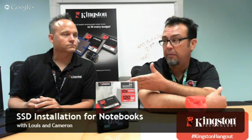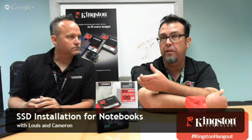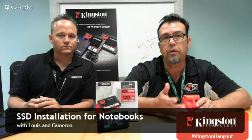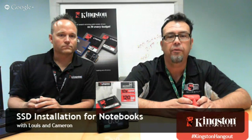It's pretty easy, and the process is almost identical to what we're doing here, except you run the clone from within the operating system. It's a pretty simple process. It goes fast. And you can use our adapter, the same 2.5-inch USB to SATA adapter that we're using. You would just basically download one of the cloning softwares as well.